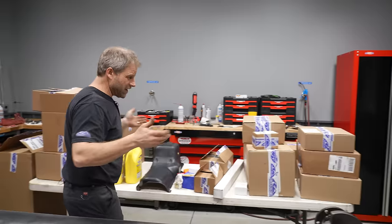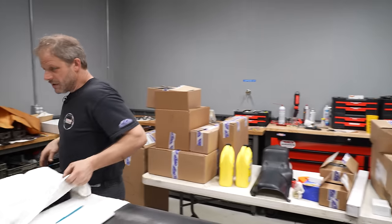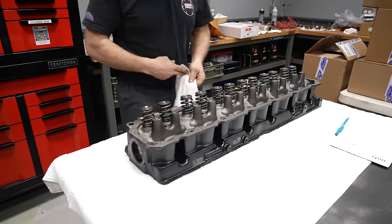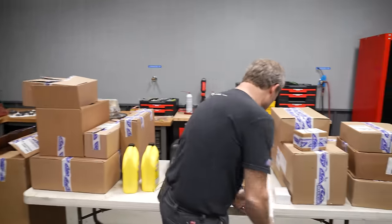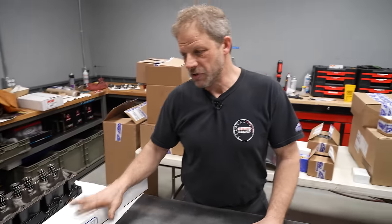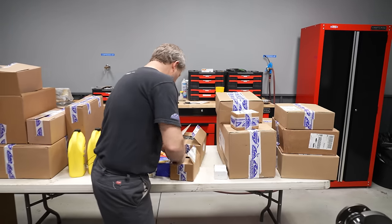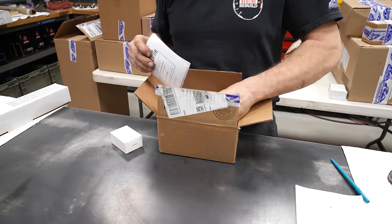We have lots of parts, and we did this a little differently because lots of times we refurbish everything. But in some of our discussions we thought, how many of the parts can we get directly from RockAuto and kind of minimize our time? So for instance, we took the easier route and got a fresh cylinder head for our engine — it has a stock valve setup and springs — and that will go along very well with our fresh camshaft from Delta. Instead of using a stock replacement camshaft, I used their performance profile setting, which gives us a little bit more duration to help fill the cylinder chamber with our extra stroke and displacement. So that camshaft will come in real handy.